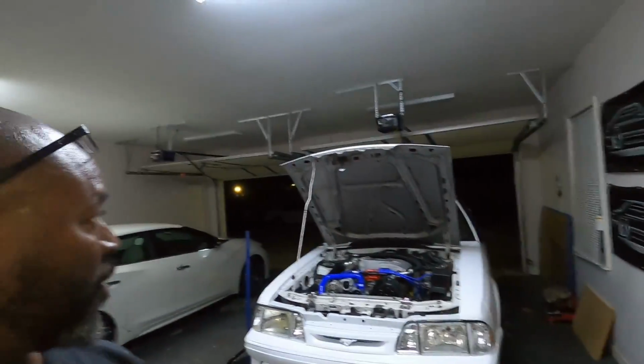Yeah, but first I gotta drop the oil pan, at least the back part of the oil pan, and reseal around there, because I think I got a slight oil leak right there. And then slap this transmission back in, and then we're gonna see if that fixed the problem, which I almost 100% know that was it. So I'll get back with you. Well, looking outside, probably tomorrow.